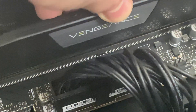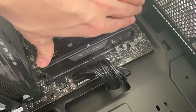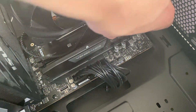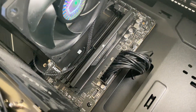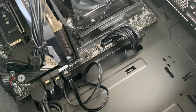I've now switched it back around and as you can see it now fits perfectly. Push down on your RAM at both ends quite firmly until you hear it click — like that — and the latches will close as well. That's it, you've successfully installed your RAM. You may have another stick to install in your other slots. Just make sure it is properly pushed in.